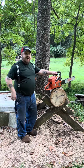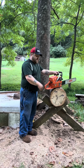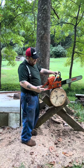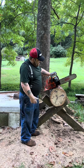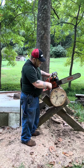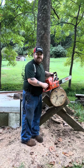268. I went ahead and put a little timing advance in it before I brought it over here. New recoil spool, new coil. Got a new aftermarket carburetor, new aftermarket cylinder, piston, caber ring, new modified muffler, a new OEM worm gear, new aftermarket chain tensioner. I got it all put back together.